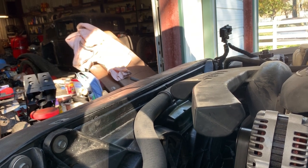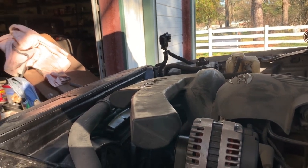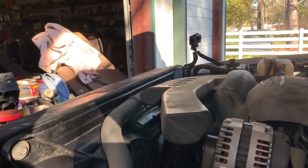We're going to let it run here for a little bit. It looks like I need to top off the coolant a little more, so I left the cap off. I'm going to let it run for a while and then make sure that both fans cut on at some point.